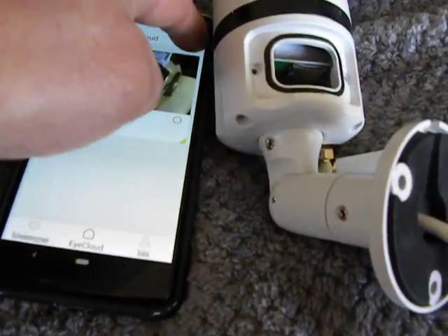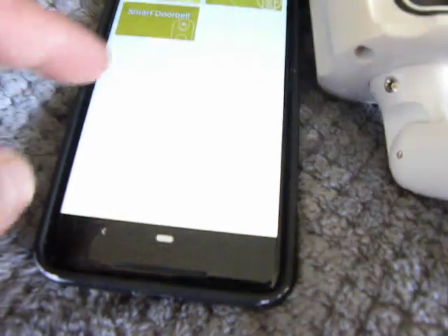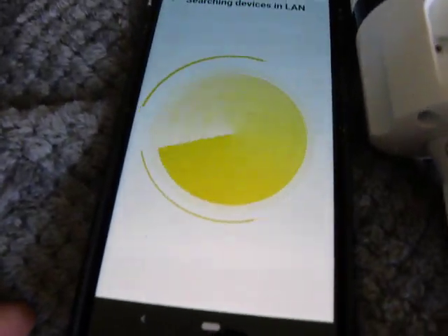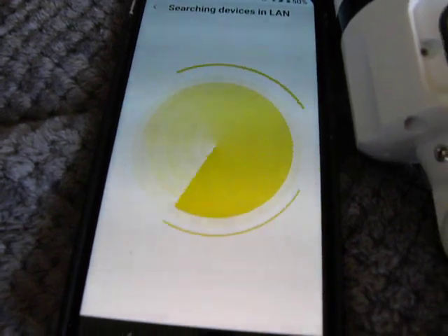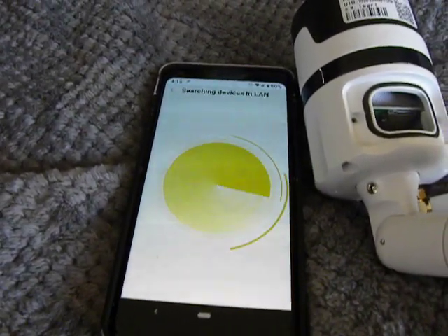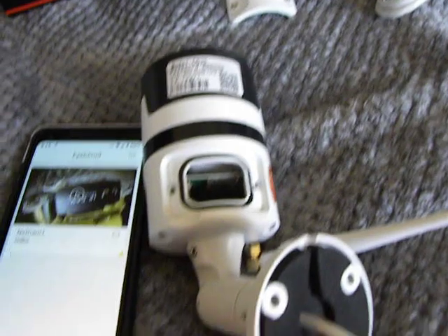There's also, if you want to hook up, you can go to add a camera and go to others and just do the IP camera search on LAN. Please connect the network cable with the camera and your router — it did. That's the way I like doing it. The RJ45 port yellow light is flashing, and then there is a voice prompt. It'll search devices on LAN, and if you plugged it into your router or modem, it'll find it and then add it. Once it's added, it's going to ask you for a password. Because it's already found it once and I've set it up, it would do that. So you can see that I do have it set up.